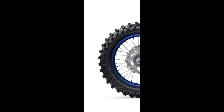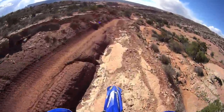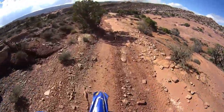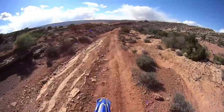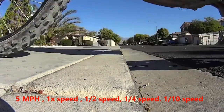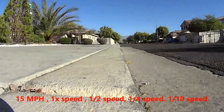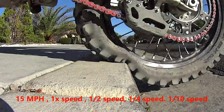How is it going to affect you and riding? When we are riding hard at high speed, you hit all kinds of bumps and things in the road. These things make a big impression on the tire based on your tire pressure. At lower speed they have less impact, but if you multiply the speed by four times, the impact is multiplied four times. An 18-inch rim allows you to install a fatter tire with a wider sidewall, making you less prone to a pinch flat or destroying your rim.